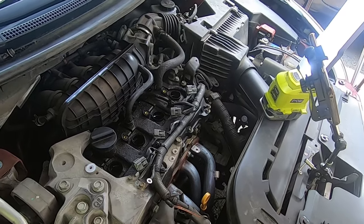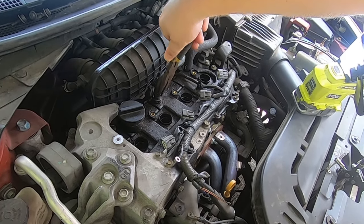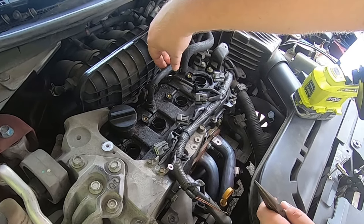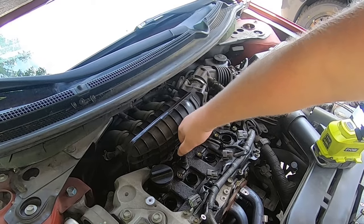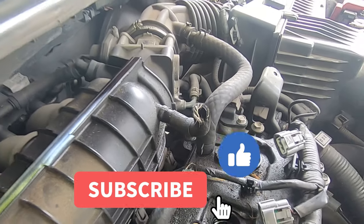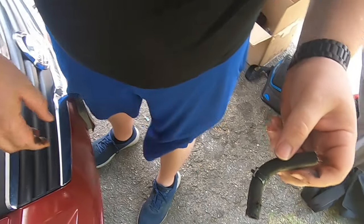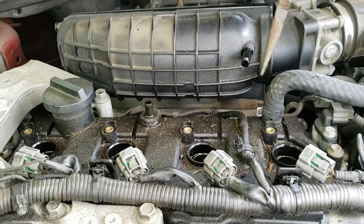Yeah, that's broke — oh well. Next step is removing these vacuum tubes. This is for the PCV — this thing gets super brittle and I can already tell if you touch it, it's hard. This thing's definitely going to break. Look at that — yeah, and here's the replacement, which is just a regular vacuum hose. That is not rubber anymore. Now we're going to take this one off here with some simple pliers — move it out of the way.